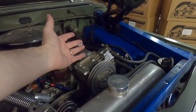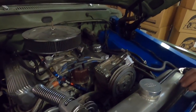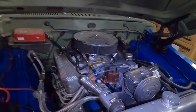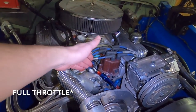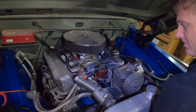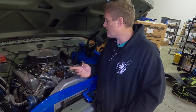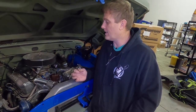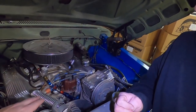There's a lot to deal with. I know the AC doesn't have a belt on it right now. We also found the thermostat housing is leaking — under full acceleration you can see coolant leaking. It's really common with these aluminum cast thermostat housings, the cheap ones you see at the auto parts store that are chromed or polished aluminum. They look nice but they have problems with leaking, especially the O-ring styles.